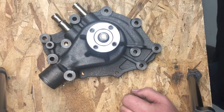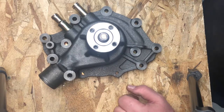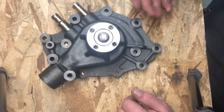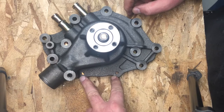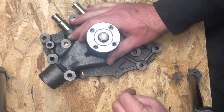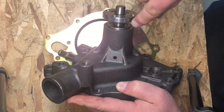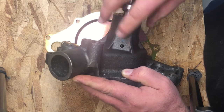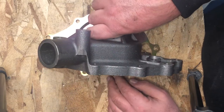Here's our new pump. Yes, I went cast iron. Why cast iron? Well, I wanted something that was going to look as close as possible to stock, and it's going to be hard to beat this for a stock-appearing cast iron pump. This is a Tough Stuff pump. It's got pressed-in water fittings just like a stock pump, it's machined in all the right places, and it's designed for your alternator bracket to bolt to it. Now this is where it gets interesting — at the bottom of this pump we have a weep hole. This hole is designed so that if the rear seal fails on the rear bearing, it doesn't push fluid through the front bearing. That just helps prevent catastrophic failure. If you end up with a leak, you'll know before it gets to both bearings, because coolant going through these bearings is going to destroy the grease in them — and then it's game over for your water pump.